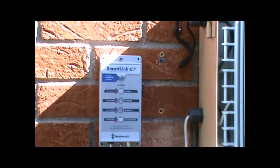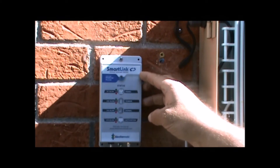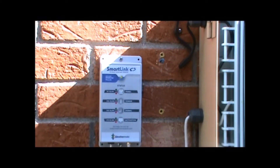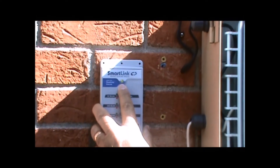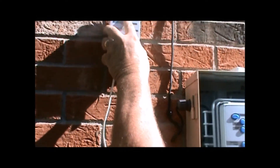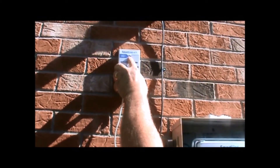In this case we have a red blink in our sequencing — the first green, green, red, green. This is an indication that we do not have a strong signal. We can rectify this by moving the AirCard up. By moving the AirCard vertically we can improve the signal strength and get a complete activation.